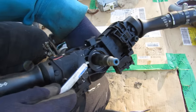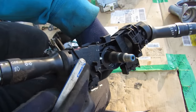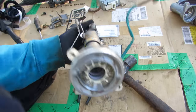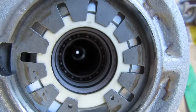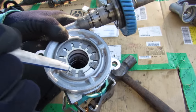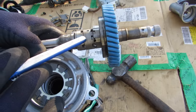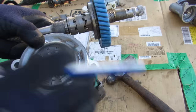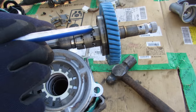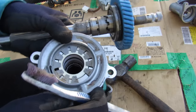If you check my steering column video you'll learn how the turn signal canceling mechanism works. Now we're just left with the steering column and shaft inside — you can tell it's got a bearing on the inside, and inside it's splined. Looking closely inside here, this is the torque sensor. You can see there are white bands inside here, and those white bands correspond to the little holes or teeth on the steering shaft. When this is plugged in and the teeth rotate, whatever sensor is inside picks up the position of these holes, and that tells the computer which direction you intend to turn.